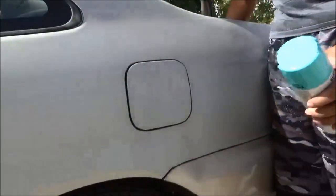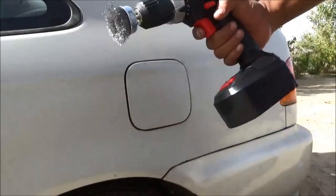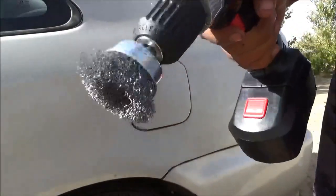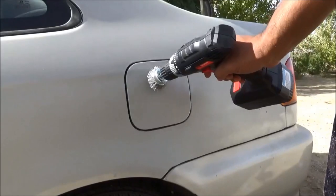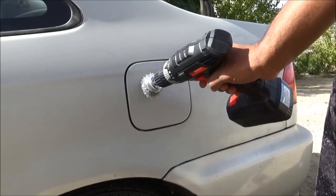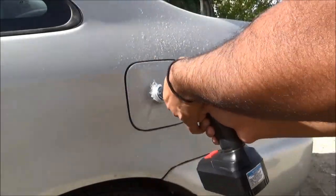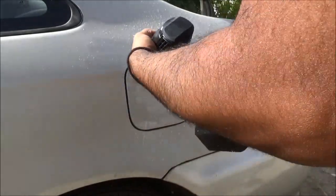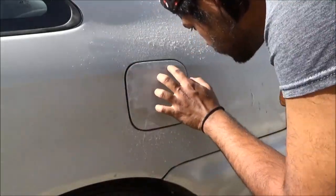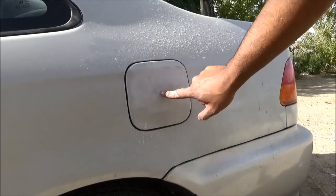The trim paint is semi-gloss black, and that's why it looks the way it does. This new color is going to be a lot shinier, which is what I wanted. So what I'm gonna do is use this wire brush wheel attachment and try to remove all this gray - it has a couple coats of two different grays because they repainted it. Let's see how this works. I can see some metal now.